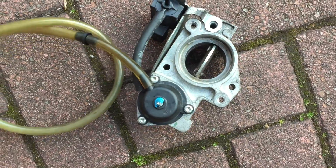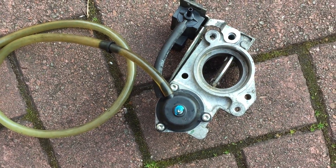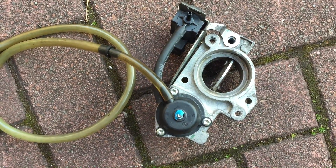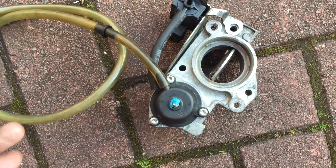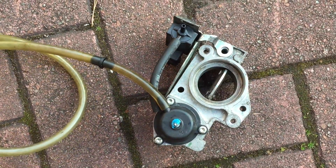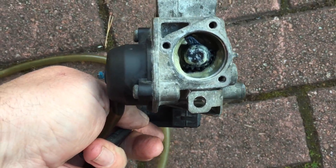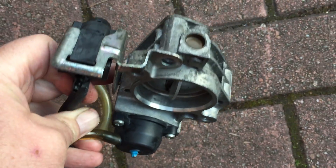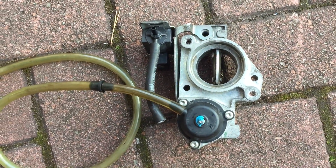This thing's only used to stop the car, because as everybody knows, the throttle valve is kept open on a diesel car - there's no need to regulate the amount of air going in. It's opening okay now, but believe me, that was sticking. A diesel only needs three things: clean diesel at the right pressure, good air and a good air intake, and a good exhaust to let the air back out. And obviously it needs to be timed up. I've put white grease on it, but I'm wondering if the spring mechanism is at the bottom.